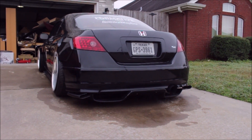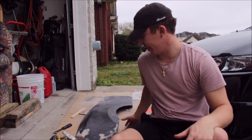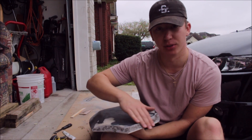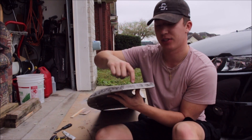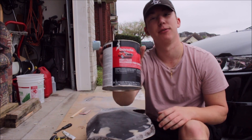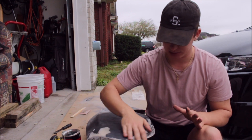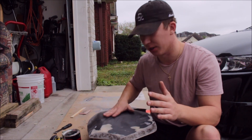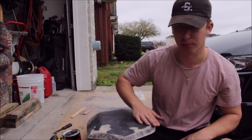It could just be because it's different, you know? Alright, so what we're going to be doing today is, as you saw in the last video, we filled all this with the Bondo glass. But what I didn't do is leave a nice smooth surface — I left a bunch of indentions and holes everywhere. So today we'll be using some body filler, cheap, get it anywhere, and we're just going to try and make this as smooth as the rest of this. We'll go over the rest with some sandpaper, maybe even some body filler on the lower spots, but right now we're focusing on the edges and making them as uniform as possible.